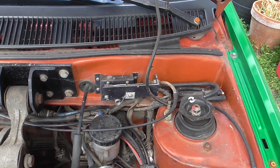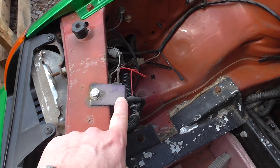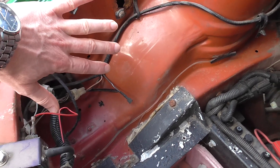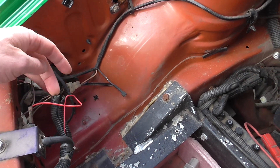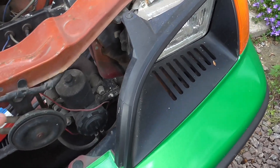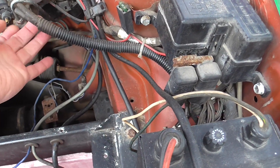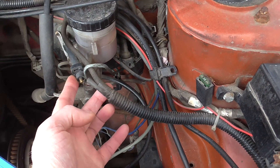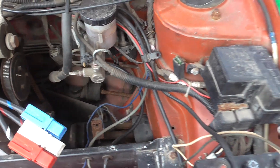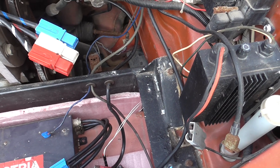The pot box for the throttle, and even things like this — there's a little bracket here which is a vacuum switch. There's a vacuum reservoir I think would have been here, but it's missing — it's the end of the pipe. There's a little vacuum pump in here, and that leads off to hook up here to the brake servo. We've got some very perished pipes. The battery box itself is made in aluminium and bolted into the structure.